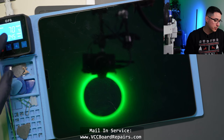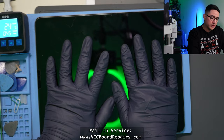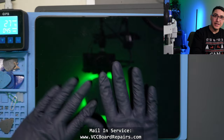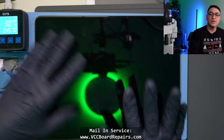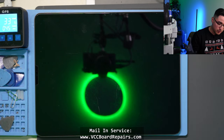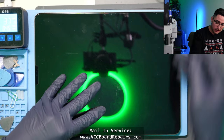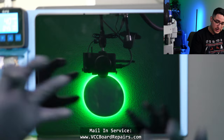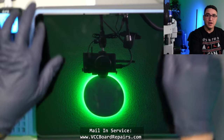Using my heat pad, we're going to turn it on to 70 degrees Celsius and heat it up for a few minutes. When heating on the heat pad, face the screen up — the frame is metal so it absorbs all the heat and stays hot. That makes it really easy to work on because this thing is sealed with really strong adhesive around the edges. With constant heat, it makes it really easy to open it up and keep attacking that adhesive.